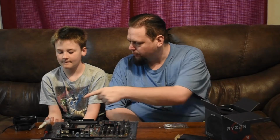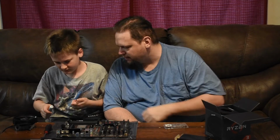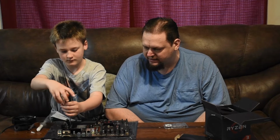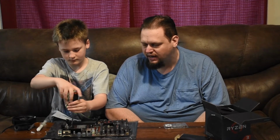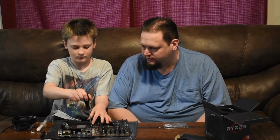So, my son Ethan here is going to do this part. So go ahead and open up the tube. So with this, because we're using the stock cooler, we're going to go ahead and get things ready to go. Alright, so now go ahead and set those down. It's okay, we'll wipe up later. Alright, so just got the tube ready to go. It will be fine open for a couple minutes, but first we're going to need to go ahead and remove these two tabs because the Ryzen coolers do not use these tabs. Only the stock Athlon coolers that I've come across do. I have not come across anything else that does. Now there may be some AIOs or something like that do as well, but for now, as far as I've seen, only the stock Athlon fans do. So each side is 2 screws, which are pretty easy to take off, pretty straightforward.